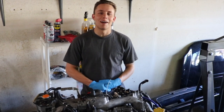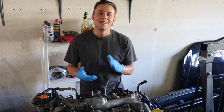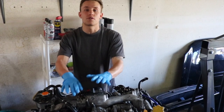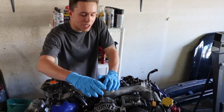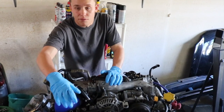What's going on guys? Welcome back to another episode. If you're new on the channel, my name is Holly and this is my garage. So this week we're going to be working on the Subaru motor. We need to take some stuff off so we can swap it onto the Japanese motor which we have over there. The first things we're going to be taking off: we need to take off the alternator, we need to take off the AC compressor, and we need to take off the power steering pump.